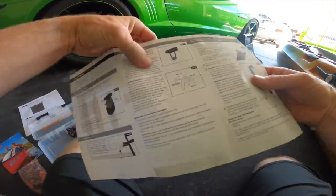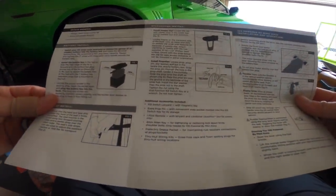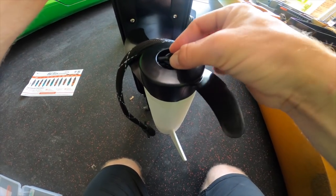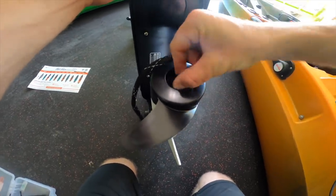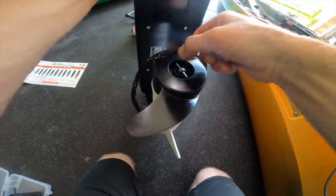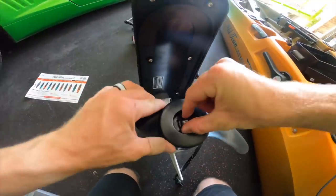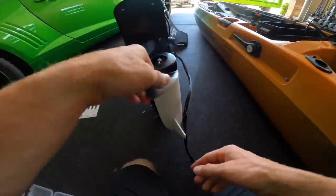Install the star washer, then the prop nut to the shaft. Tighten the nut using the dual-function kill switch key as a wrench - do not over tighten. Star washer's on, prop nut is going on. My threads seem a little off but I applied a little pressure on one side and now it's going on even. I'm going to hand tighten this. I'm already spinning the prop so that seems good - I'll tighten until those pieces are covered. Snug as a bug in a rug.